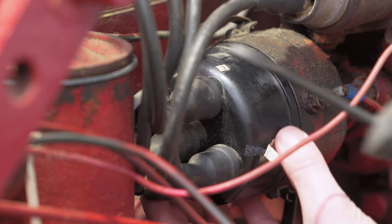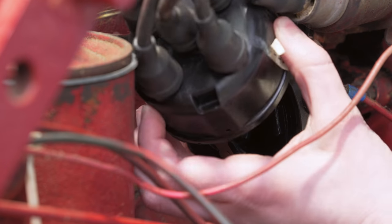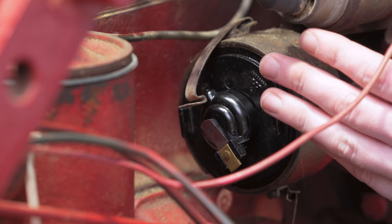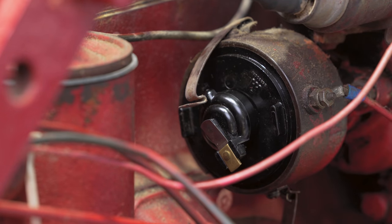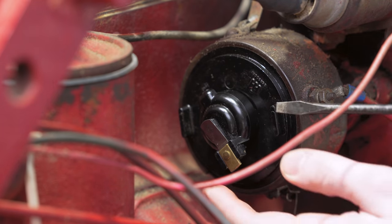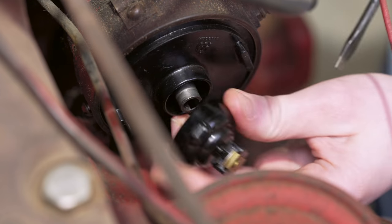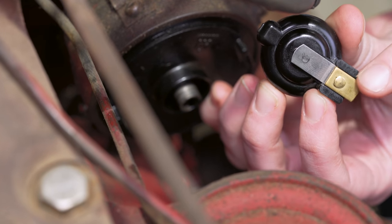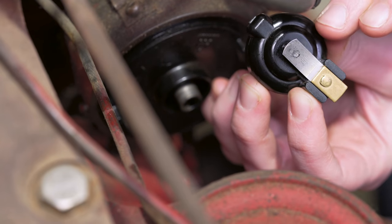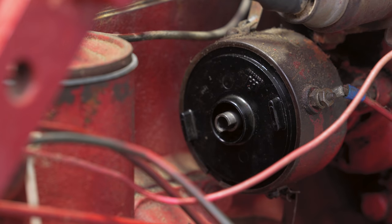There are just two metal straps that hold it on and a screwdriver like this will help you pull that off. Once you have it free, the cap with the wires on it will just pull right out of the way and you can set that aside so that you can see everything that goes on inside the distributor. The first item you're going to see is the rotor. These are often burned up — you can pry it off a little bit if you need to with a screwdriver. Sometimes they'll be stuck on there, but this end will sometimes be burned or this little tab right here will either be broken off or even have a hole burned through it. So inspect your rotor — if you don't have spark, that could be the reason why.